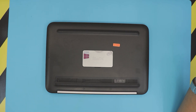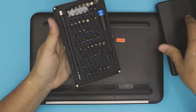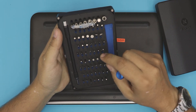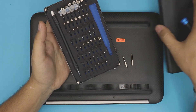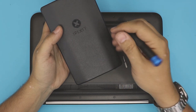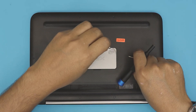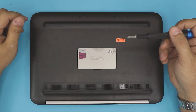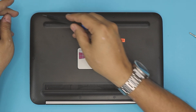Let's open this thing up. Number one, you need to grab yourself a screwdriver set. I use the iFixit tool set, and we're going to be using bit number four — Torx number four — and Phillips number zero. I love this tool set because the bits are really hardened and they last a long time, compared to some off-market ones. So we're going to use Torx number four and remove all the screws at the bottom cover.